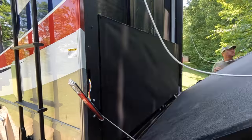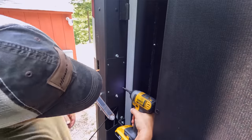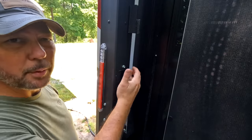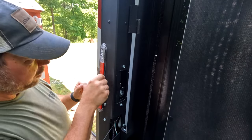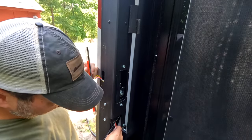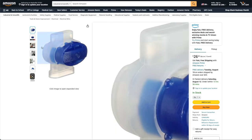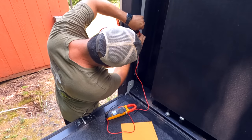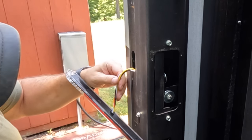I'm gonna go back there and meter some stuff out and see what's what. I got the left taillight removed to see what we were dealing with. Then I opened our ramp patio door and removed part of our patio railing to get that out of the way. I was able to access the small panel on the side that accesses the door lift mechanism, which is where I can also access those wires a little bit better. None of this mechanism goes up and down — it's just a cable that goes up and around and down, so I'm not too worried about stuff moving in here. I also determined that these four wires here do go down, in a nice wire loom. After taking that panel and getting access to the wires, I realized they were using three-wire self-stripping moisture-resistant taps, but only two of those were being used. So the other tap was open for me to put the probe in there. As I talk about wire colors in the RV, I'm referring to the wire colors coming out of the back of those tail lights — that's gonna be pretty stock. What they connect to inside the RV is anybody's guess. It could be any color, any kind of wire, so I'm not even gonna talk about those.